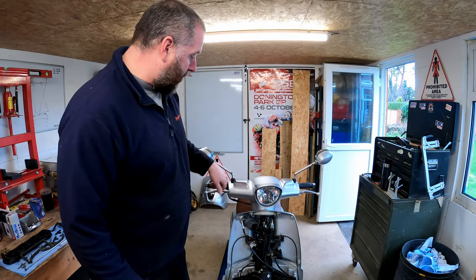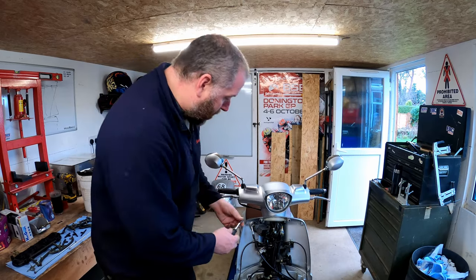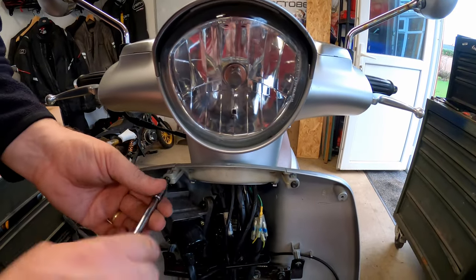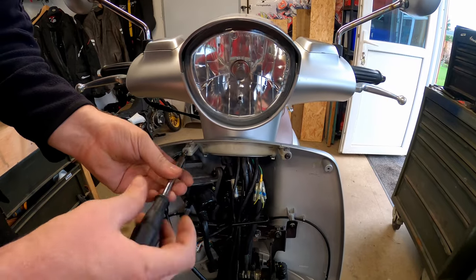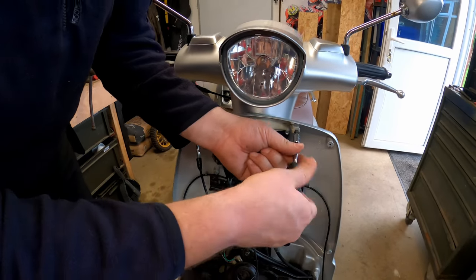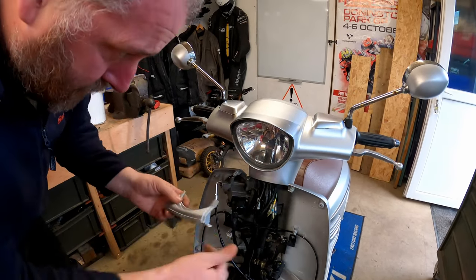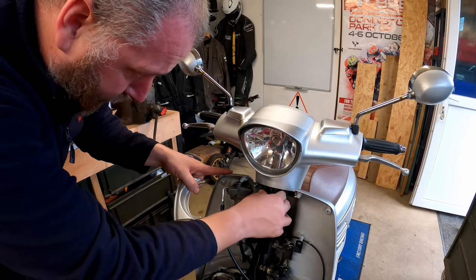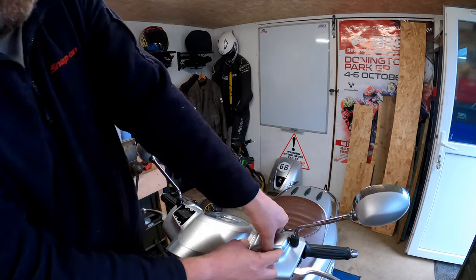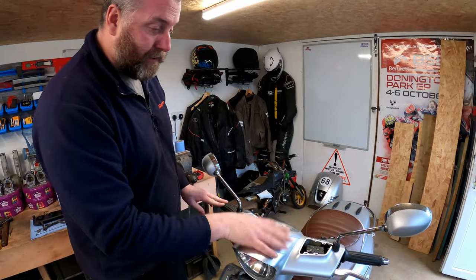Because these are handlebar grips, we need to route cabling down to each of the handlebars, so the top fairing does need to come off. First, we need to take the sheath guide — this little plastic trim — which is held on with T25 screws. That pops up and gives access to most of the cabling. Next, the two covers on top of the master cylinder reservoirs can both come off, and then we're going to remove the screws for the top cowl.